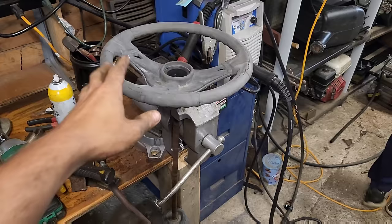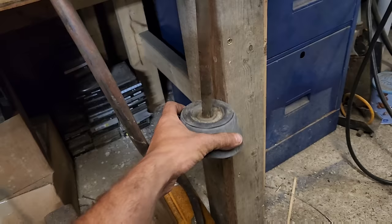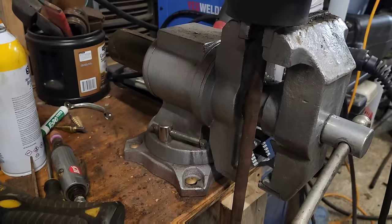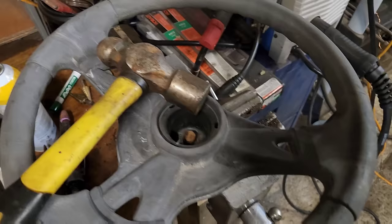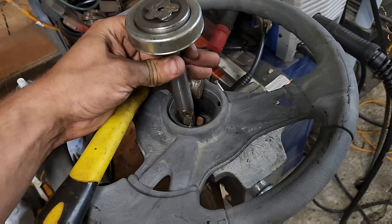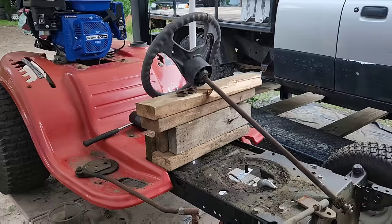I get asked about these MTD steering wheels quite often, so I'm going to put it in this video. See how this still has the steering column piece off the dash on it, and still has the gear and everything on it - that's because the easiest way to get these stupid steering wheels off is to put them in a vise, get about an inch and a half long five-sixteenths coarse thread bolt, thread it in, use a hammer and some sort of punch - this is my custom deck spindle punch that I like because it protects my hand from getting hit. Say a prayer to whatever deity you believe in and hope it pops out - otherwise that's about the only way these things come off.